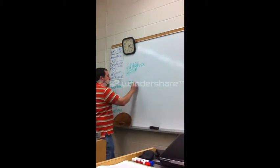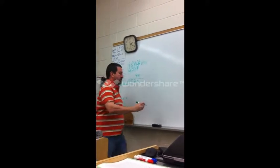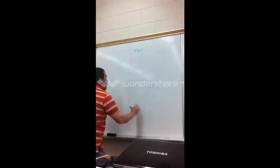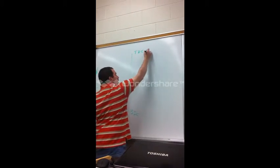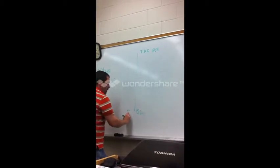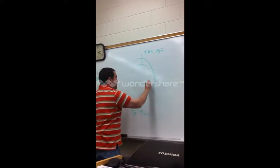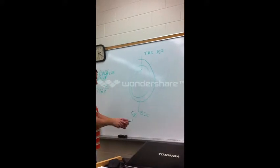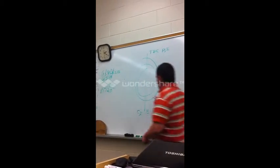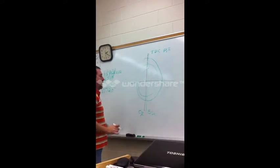And it's 720 degrees in an 8-cylinder. How far apart are our firing intervals? 90 degrees. What strokes start at TDC and come down? Power and intake. And what strokes start at the bottom and go up? Compression and exhaust. We have to go around twice to get all 720 degrees in, and our firing intervals are 90 degrees.